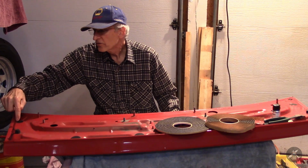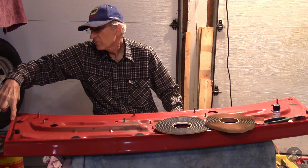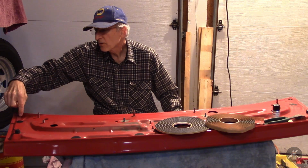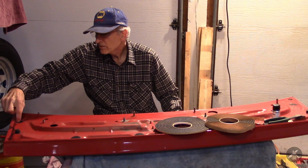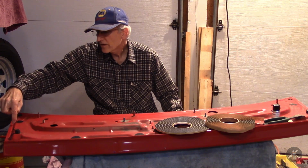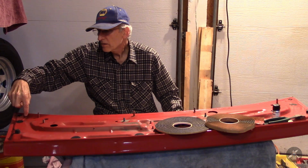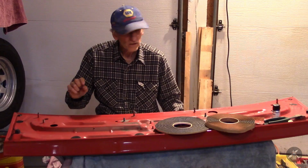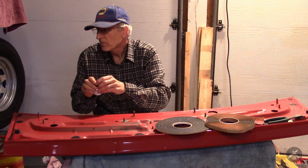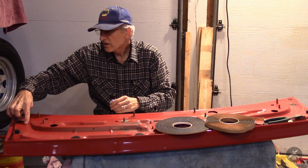I know I measured with tape in the beginning, but the service manual shows a dimension from the top of this bump back, and from the bottom of it forward. I believe it's 1 3/16 inches this way, and 13/16 of an inch that way. And they want that area to be applied with urethane primer, because that's where the urethane will get spread. So there's a measured area across.